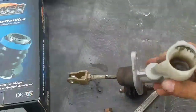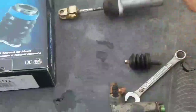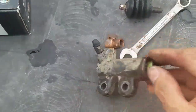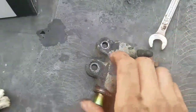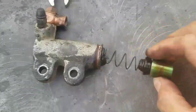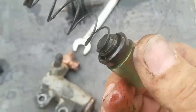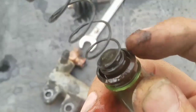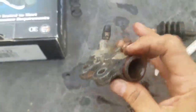Here are the old parts. This one — if it wasn't for that sludge, it would probably be fine, but it's old. This one is the one that actually messed up. Let me see the seal on the inside. I'm not too sure how this thing messed up, but what I'm going to do to take out all that contaminated oil is just get the compressor and blow on it with the air blow tool.